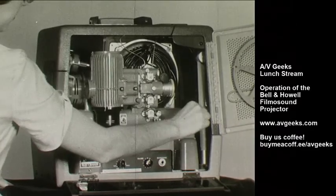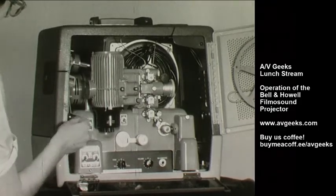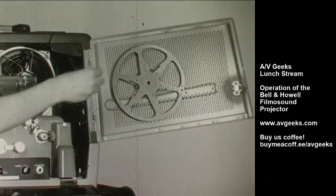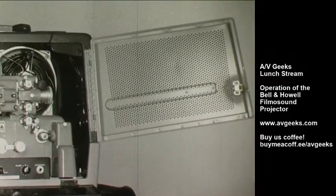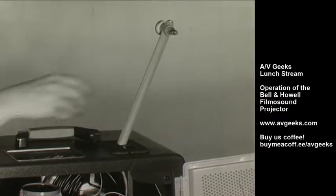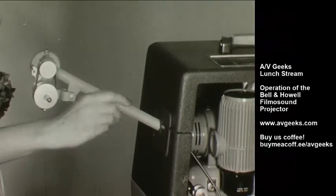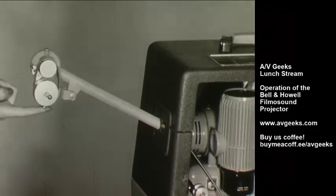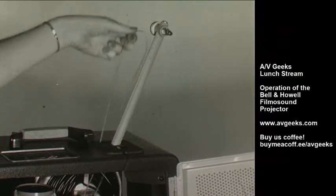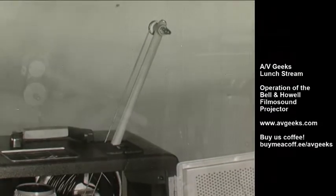Feed reel arm. Take up reel arm. And empty reel. Insert the feed reel arm into its socket at the top front of the projector case. Then insert the take-up reel arm into its socket. The take-up reel arm gears should be disengaged. Loop the two spring belts over the pulleys of both feed reel arm and take-up reel arm. Be sure that the belts are not twisted.